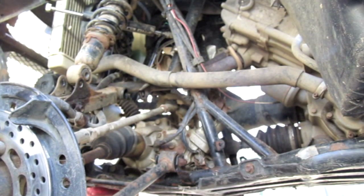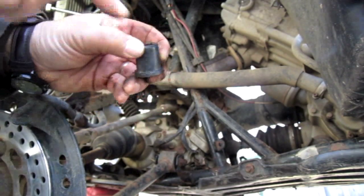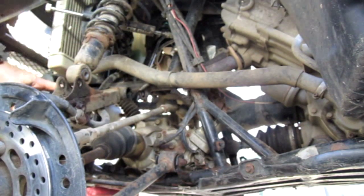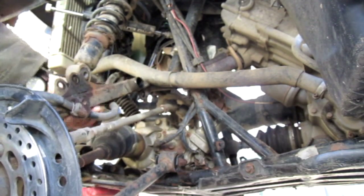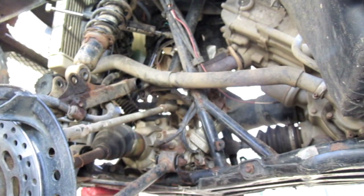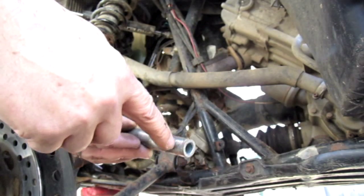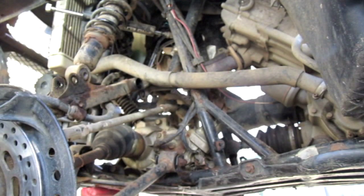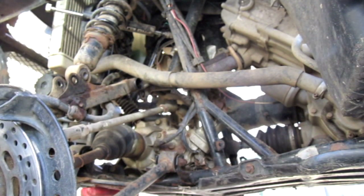That is the bushing. If you're careful it won't mangle up the inner side. The trickiest part is going to be getting the cutoff wheel around this to take off the 0.187 on the kingpin. That 0.187 also has to come off the other end, but I think I'll do that in my lathe. Some people grind it down — in any case it has to be brought down by that 0.187 as well.